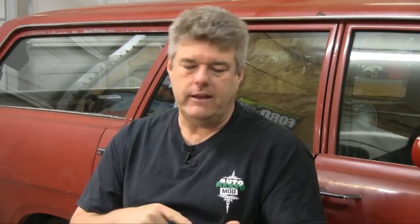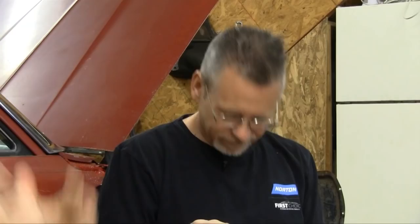Now we're going to bring in some chemical stripping props to show the guys one of the oldest methods for stripping a classic car. Chemical stripping is probably one of the oldest, most tried-and-true methods that slowly but surely the federal government is trying to get rid of — even here in the South. Even in the great South where people have been redneck stripping cars for who knows how long, it is getting that way. Why is chemical stripper becoming such an issue? It's really not to do with the stripper itself — it's how it's disposed of, because it has to be washed off the vehicle.